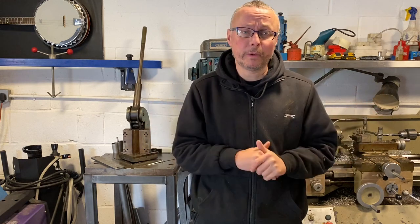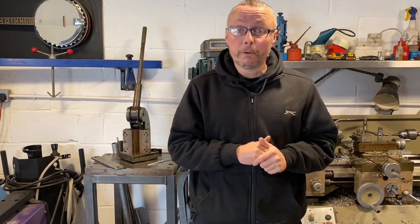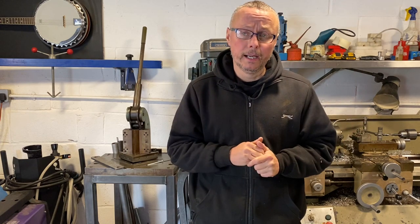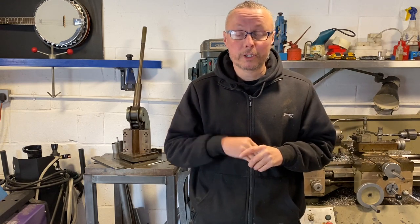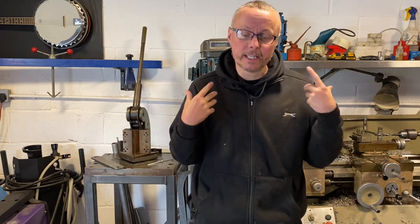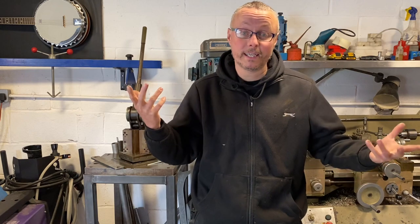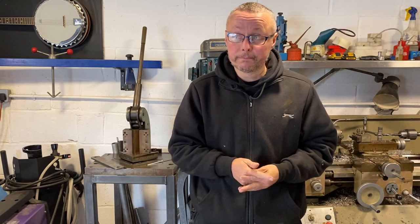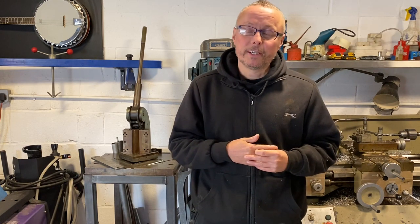He's due any minute, so let me have a quick tidy up and then let's get into working on Danny's car. Let me tell you what we're going to do: Danny has an F28 six-speed gearbox in his car. They have a speedo ring inside the gearbox — if you don't change the speedo ring, your speedometer will always read out by about 20 miles an hour. So you have to take the box out, split the box, take the original speedo ring off the F28, and put on what's called an F20 — a five-speed gearbox speedo ring. Put that on and the speedo's corrected. That's what we're doing today.